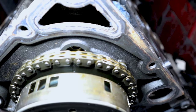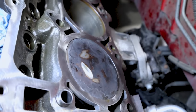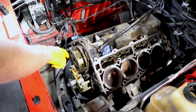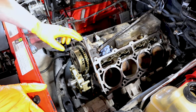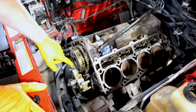You can see on our camshaft sprocket our vertical mark is at 12 o'clock and our number one piston is at top dead center, so engine timing is set. Our torque spec on the camshaft sprocket bolt is 90 foot pounds. Camshaft sprocket is locked into place and the bolt is properly torqued down — we know our timing is good. The camshaft is fully installed.